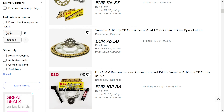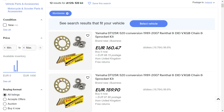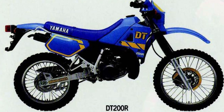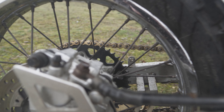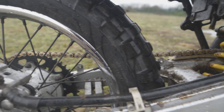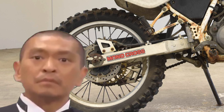Some sellers list these as conversion kits for the 125, but really they're just OEM sprockets from its big brother, the 1990 DT200R. I also found out some other parts that bolt onto the 125 are the lighter aluminum rear swingarm and aluminum rims. Look — no rust!